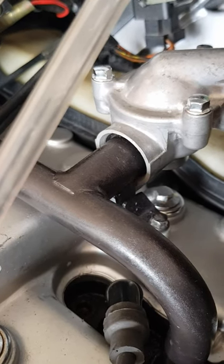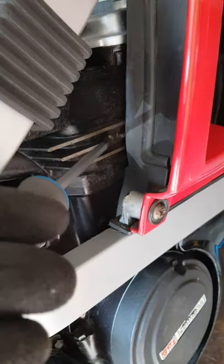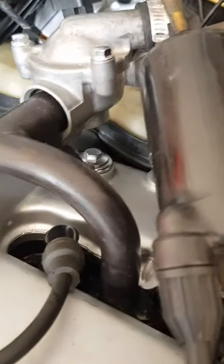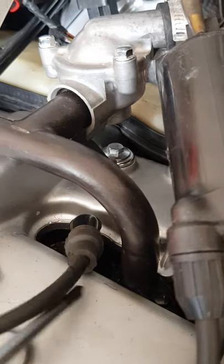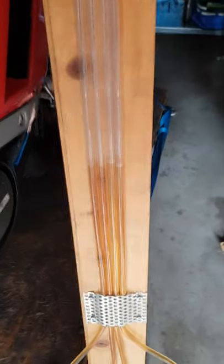And just to answer another question from someone else, if you find you have fluid coming out of this drain hole here, then it's more likely to be the leaking thermostat dripping into the hole where your plug is at number three, and that's that. So, I'm gonna crack on with this.